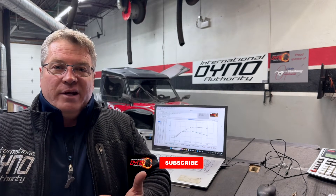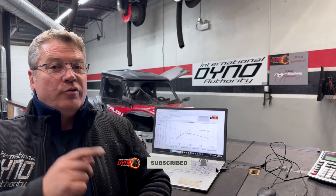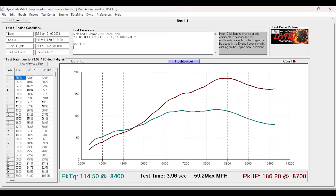After that we wanted to make some more runs but not at 11 pounds — we added another 6 pounds up to 17 pounds of boost. That's about the limit of what you're going to do on 91 or 93 octane, and you don't really want to have to go to E85, so we checked that as well. Here we go. On 17 pounds of boost we notched the torque up to 114.5 foot-pounds and brought the horsepower up to 186 at the wheel.